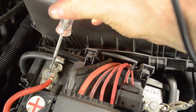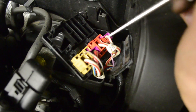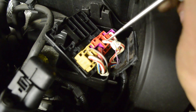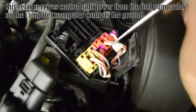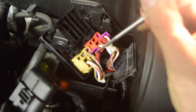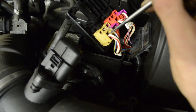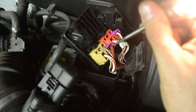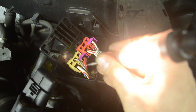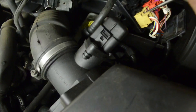Here is our secondary air relay. I have my test light connected to battery negative. When I receive power, the test light lights — conventional relay operation. I should have two powers. With this one you have to have the engine running for the computer to send the power on the control side of this relay — it is ground side switched. Test light lights, that's one power, and down here my test light lights. This is the feed on the load side; this is the feed on the control side. All I need to do to give this a ground...